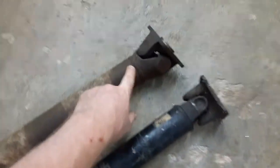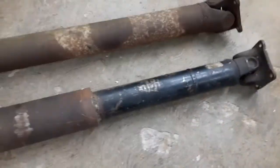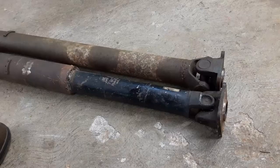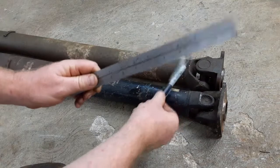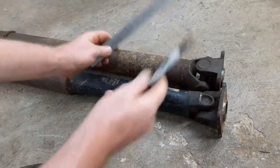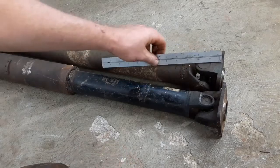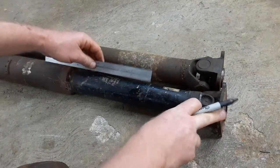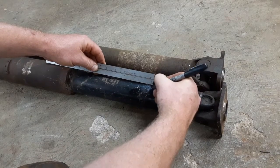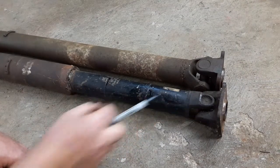So let me take a measurement from there to there and I'm going to cut it probably somewhere in here. It really doesn't matter. I'll leave this weld where it is and then just weld this tube back together. So it looks like when I made this drive shaft I made it about a half inch shorter than my mock-up. I'm sure that was because the slip fit was too far into the transmission, but this one worked fine. So I'm just going to go a half inch more than what I have marked — that puts me right there. So we're looking at about four and a half inches we need to remove. We'll just go from there to there, cut it there, cut it there, and then weld it back together.